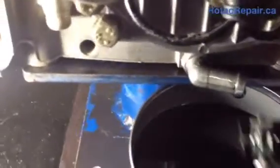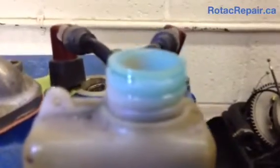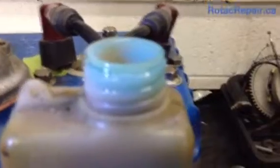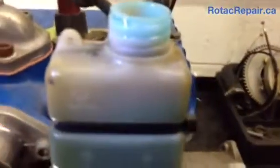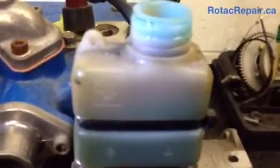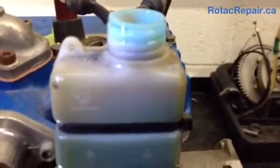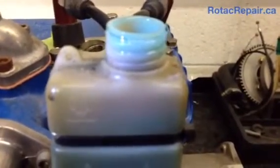The oil is all out now — a little more will come out if we leave it longer. I've already pre-cleaned the area so there's no dirt. It goes back together and we'll tighten up the clamp. When we come back up to refill it, we're going to fill it with the two-stroke oil that we burn in the engine — either via the oil pump or premixed in the gas — we want to use the same kind of two-stroke oil. Fill the reservoir with the appropriate oil up to the right level. It's very important to get the right amount of oil in before you start it, because if you start it with not enough oil, you'll damage the crankshaft and the rotary valve shaft, which equals a whole bunch of money wasted. Measure it in a clean brand-new measuring cup — three hundred and ten milliliters. You should get pretty much all of it in there.